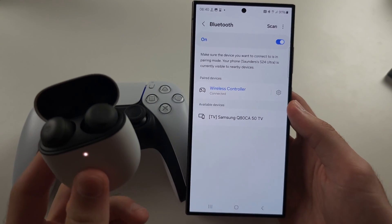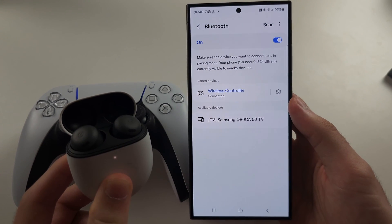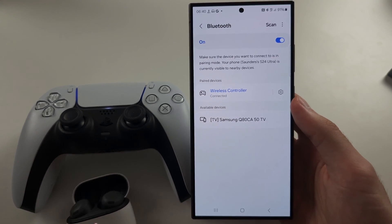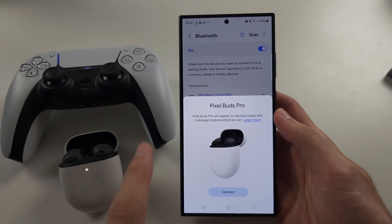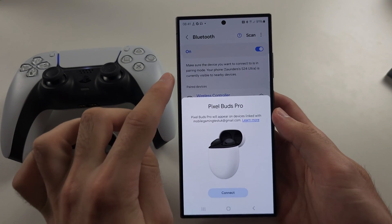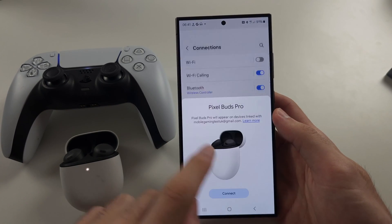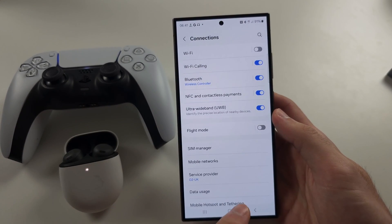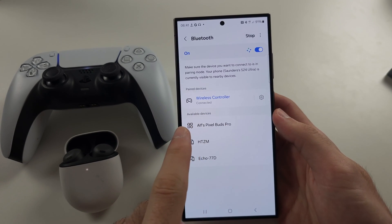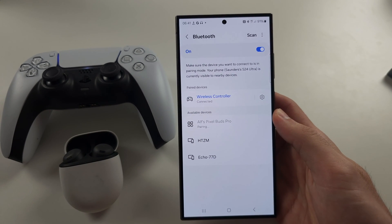The second solution is for hands-free devices like Bluetooth earbuds — they have a custom pop-up which will show on your Samsung. But this custom pop-up doesn't actually allow the connection to work. So if your Bluetooth device shows this screen with a connect button, don't tap connect. Tap on the empty space to dismiss it, and then go back into the Bluetooth settings. You may have to dismiss it multiple times, and just tap the device inside the Bluetooth settings instead of using that pop-up.